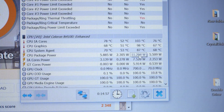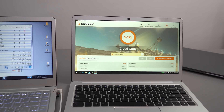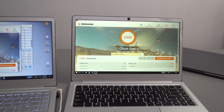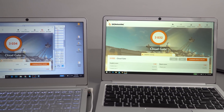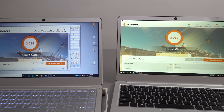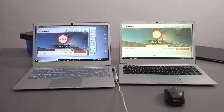I guess if it wasn't thermal throttling that would probably go up to about 15 watts. You can see here that the Teclast F7 with the Apollo Lake N3450, without any power limits — because I run no power limits on that one in the BIOS — gets a score of 3032. And you saw my score here that I got with the new Gemini Lake N4100 without any power limits but with heavy thermal throttling managed to get more or less the same exact score.